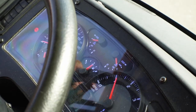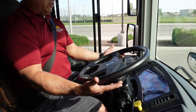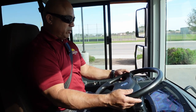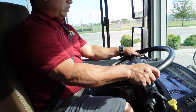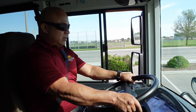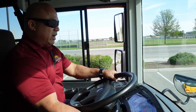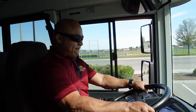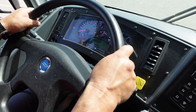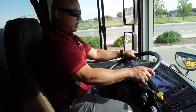I charged my system to a little over 100 PSI. The first test I'll be looking for is any pull in either direction. I'm going to let my bus roll forward with my hands off the steering wheel, checking for any pull in either direction. Any pull will indicate that the front axle brakes are coming out of adjustment. There's no pull. I'm going to apply my service brake once more, listening for any unusual noises — any unusual noises also indicate that the front axle brakes are coming out of adjustment. The next test is applying my parking brake, checking for stopping distance and making sure it's consistent with previous pre-trips. If not, that'll indicate my rear axle brakes are coming out of adjustment. The last test: since my parking brake is applied and my bus is in gear, I'm going to throttle up to about 1,100 RPMs to make sure my brake holds. And my brake holds — that concludes my pre-trip. Thank you.